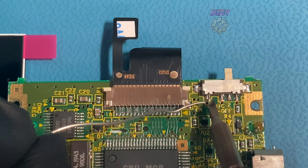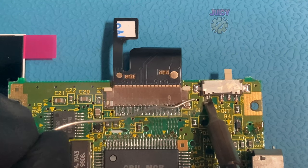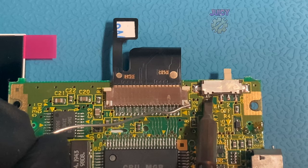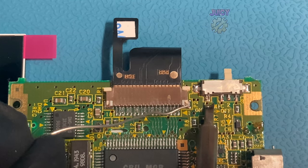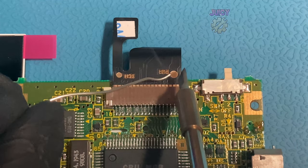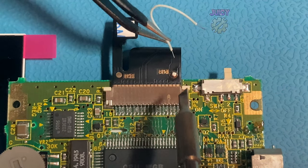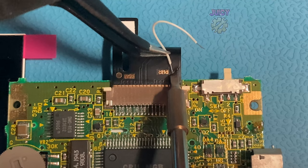Unfortunately soldering is required so I am going to solder a wire on, but I'm not going to do it perfectly because again we're just trying to test the kit. So heating up this joint and adding some fresh solder on the power switch and then tinning the pads marked power on the ribbon cable itself. Getting the provided wire I can then join these two places together.